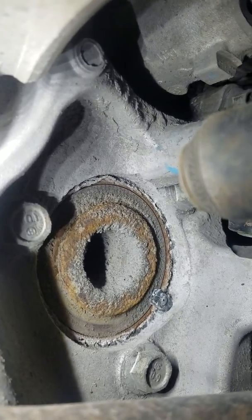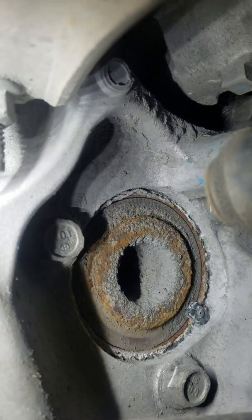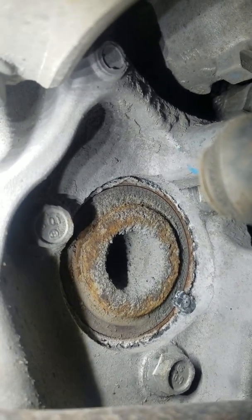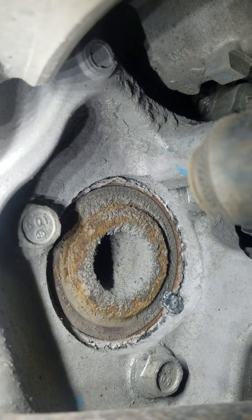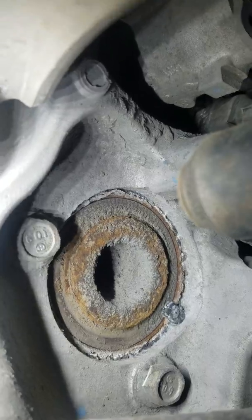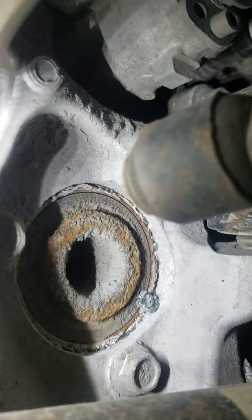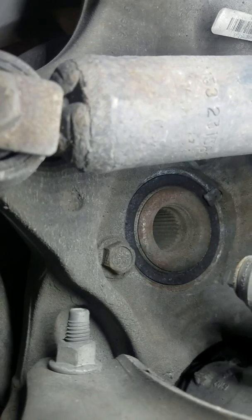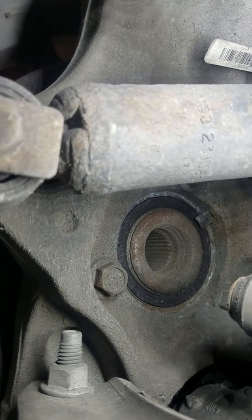The fix for that was replacing the sensor — that was easy. So if the tone ring's not damaged, it could be the sensor. I highly recommend, if you replace the sensor, clean all that dirt off — blow it off, brake clean it, whatever you have to do, spray it off with water. It's going to collect gunk again, but you've got to do the best you can to keep it off. This other side is super clean — just a little gunk on it, but it's not a big deal.